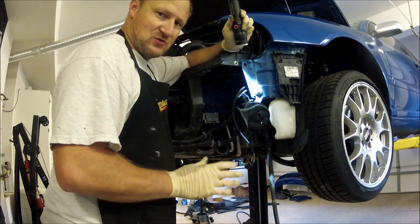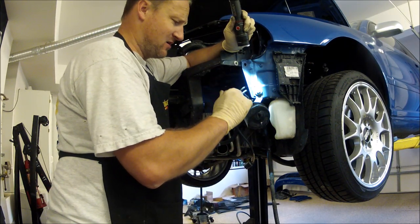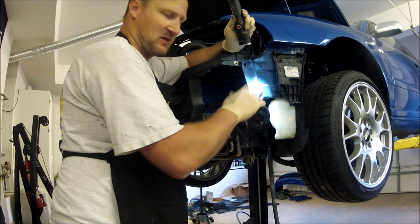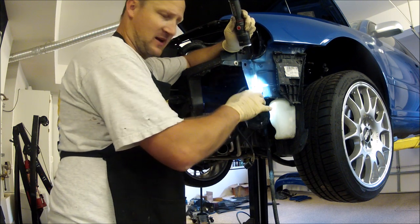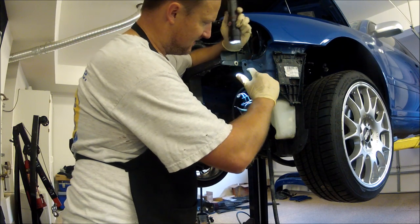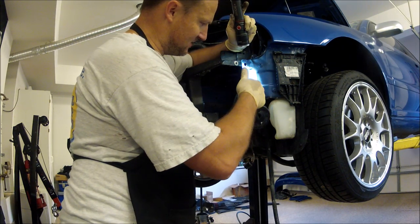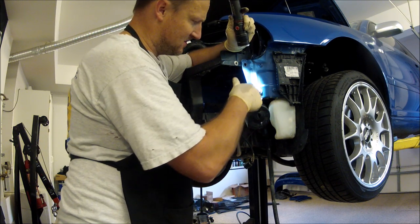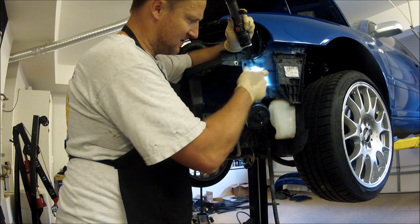There's some issues with horns fitting really well. I think on my car, and most of them, I take off the driver's side horn. If you can't get it to fit right with the bumper, it pushes it way too far out. Then go ahead and remove this, and then when you cut, we're going to draw it out, you'll cut here, and then down. I'll try to save where this bolt goes, but you do remove a lot of this out of the way.